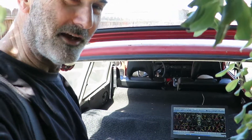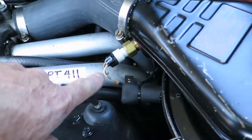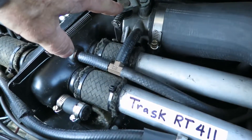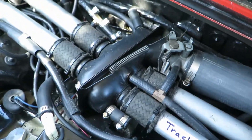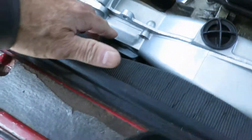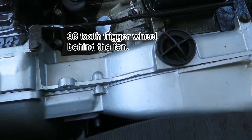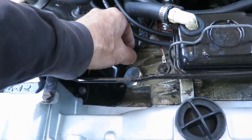I'll try to give a quick breakdown on everything. This is the intake air temperature sensor mounted on the stock oil bath air cleaner. Down below the throttle body I have the throttle position switch — TPS. I have the wasted spark ignition module, and underneath — you can't see inside the engine — I have a 36-tooth crank sensor, and the wiring is coming up right here.